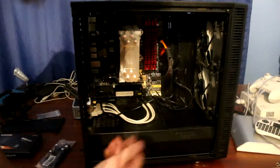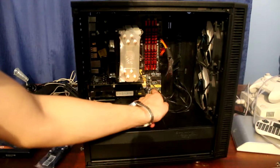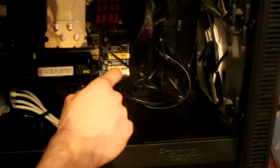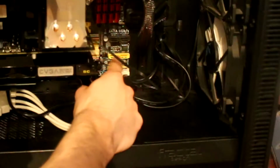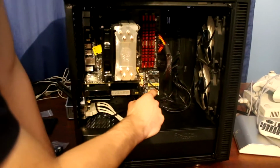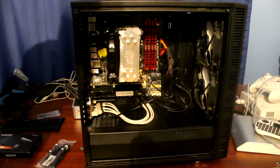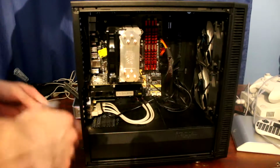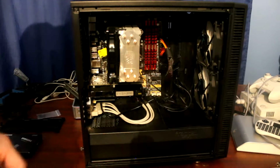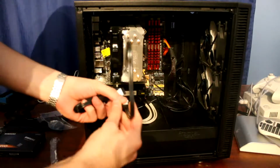It's really good. So as you can see, these are the 2 cables here that used to be in, I think these are the old motherboard cables. They're both connected here in the SATA 6 ports, and we're gonna connect them in the other SATA ports here. We have 4 SATA 6 and 2 SATA 3. I don't think it's gonna matter much, but might as well plug it in the 6th one, why not? And now all we gotta do is plug both cables.